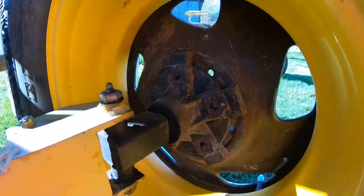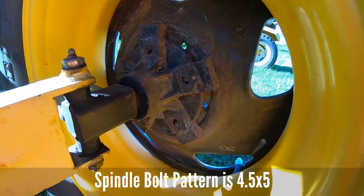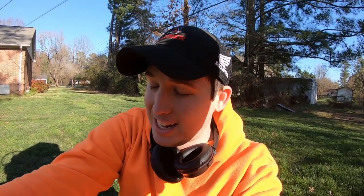prevent wear. To make the front spindles, we used trailer hubs, but because the bolt pattern for the wheels were not correct, we ended up welding on little tabs. Then we spent forever trying to drill them so we could push lugs through, and eventually we decided just to weld our lug bolts onto them. It's kind of sketchy, but it's held up for like the last 8 years or so.